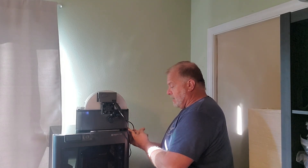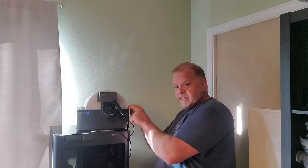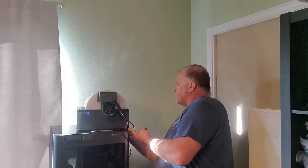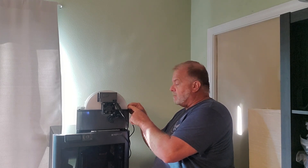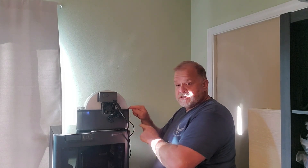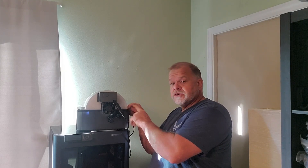If you don't know how to take off your AMS lid, it was kind of weird to me at first too. On this side, underneath, you can get an Allen wrench — you need a longer one, good four or five inches. You can reach up and on the bottom of these little hinge blocks there are two screws, one on each side of a rib. Once you undo those two screws and bring them down — catch the screws — there are two little blocks that come out. The print design calls for a three millimeter pin. You don't have to use three millimeter screws — you can use a wire hanger, a pin, whatever — but it's three millimeters that goes into this block.